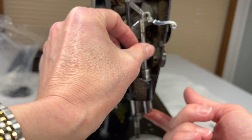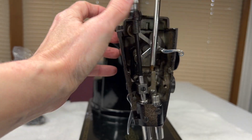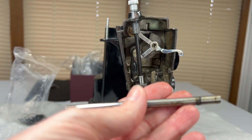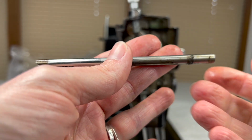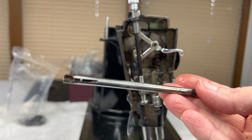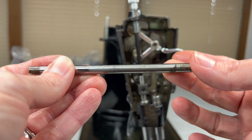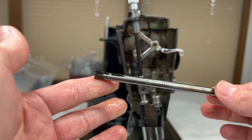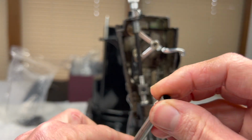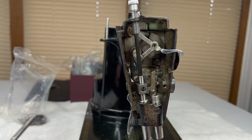Now I'll go ahead and push it up and pull it right out of the bushing. And here is your needle bar. So you can see that over the years, it has collected quite a lovely buildup of dirt and grease and oil and dust. And this is just really yucky. So we'll clean it up. We'll make sure to get a brush into this little groove here and get all that gunk out. And also clean down inside this hole. And put it back on.